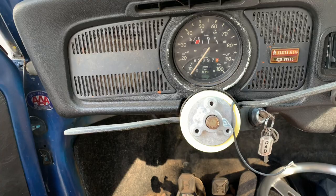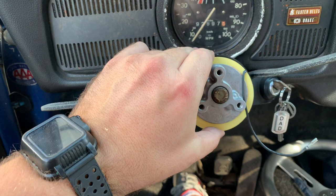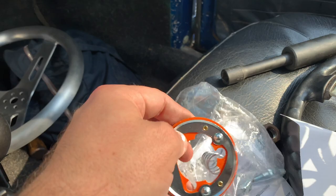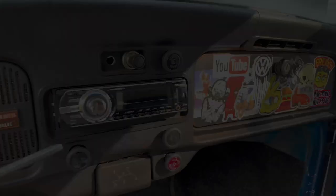So this goes down again. Make sure your wheel and everything is straight really before you get this started, because if it's off just slightly you're going to notice it when you get the wheel on, so try to get it as close as you can. Then we're going to start putting it all together. You've got your horn mechanism here. The instructions also say that you'll probably have to bend that little horn metal piece up to the actual hub to make sure it's going to hit. And now he's got a little air horn out there, so it works.